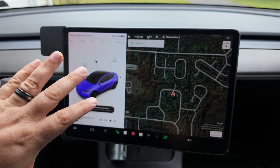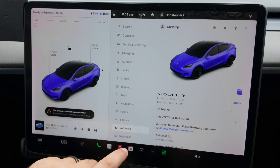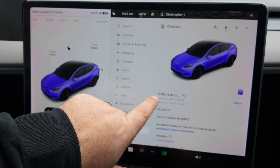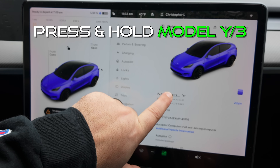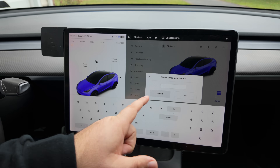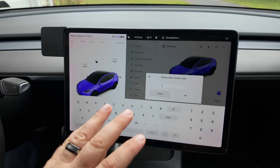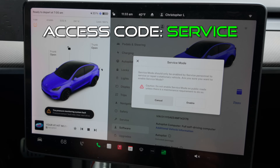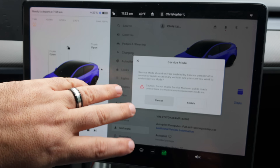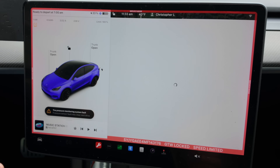To run this test we have to go into service mode, which is pretty easy. Bring up your dock, go to Software, and where it shows your car's model name, touch and hold that for about five seconds. That brings up a service code password box. You then enter the access code — the code is 'service', all lowercase — and hit Enable.